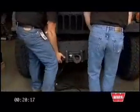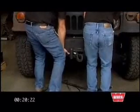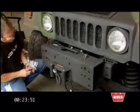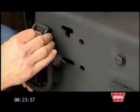Next, lift the winch kit and slide it onto the new frame extensions. Slide the kit side to side so that the winch is centered between the frame rails. Once the kit is centered, slide it into place against the frame extensions. Reattach the shackles through the new holes in the kit's frame, then install the new fasteners that are included in the kit.